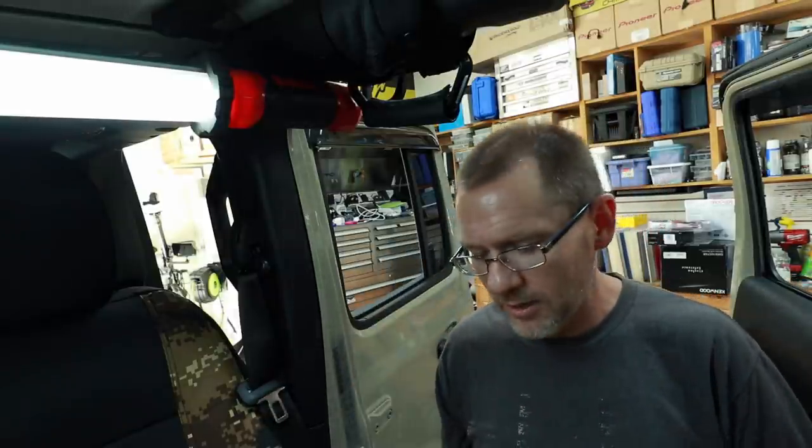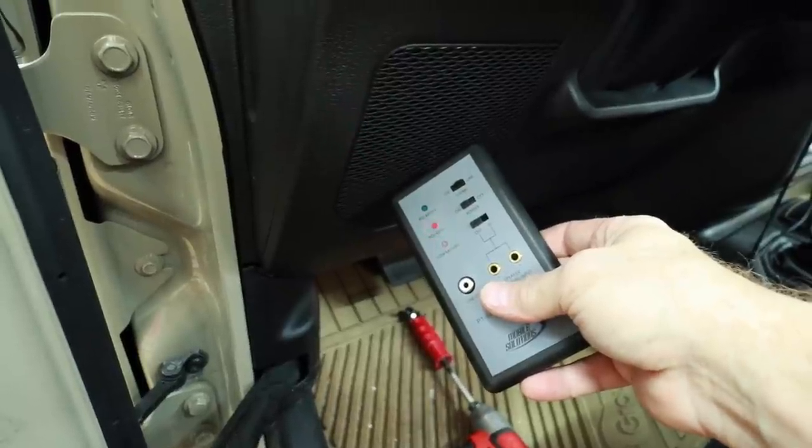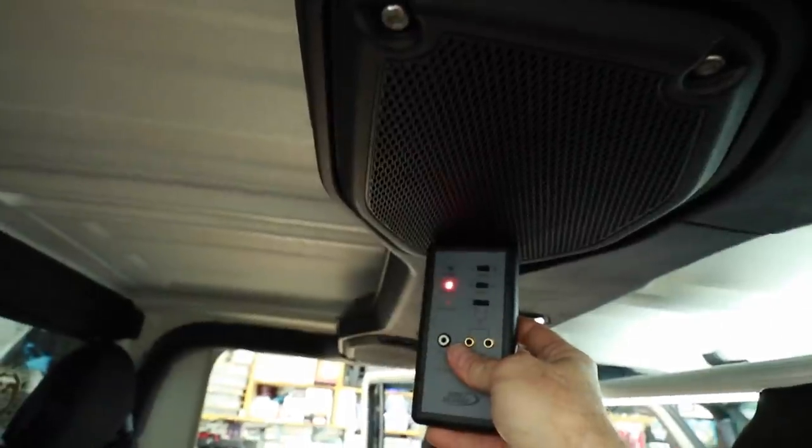Even though we've already taken the speaker out of the dash, there are a few steps we need to take. The first step is a polarity check. We want to see what the factory speakers are doing as far as polarity because we're integrating back into the factory stereo. We want to make sure we don't change anything and don't affect the way the speakers in the top of the dash play compared to the speakers in the bottom. For that we'll be using the PT9A Plus playing a polarity test track. Starting with the bottom mid-range, we are getting a red polarity. Top mid-range is also giving us a red polarity. So both the bottom and the top are playing in the same polarity — both red. We'll keep going and check the rest of them: Red. Red. Red. Red.